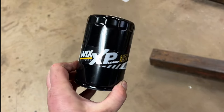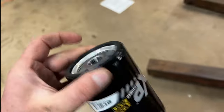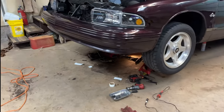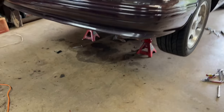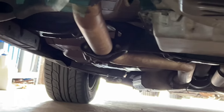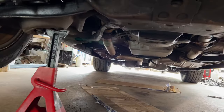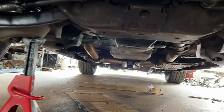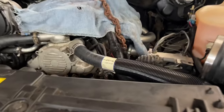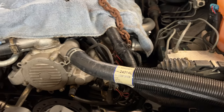Going with the Wix XP high-mileage synthetic oil filter — my old filter wasn't great, so we'll throw this on. Hopefully button things up on the top side. Oil filter installed, starter installed, exhaust is back on. On this side it wasn't routed through the proper bracket, so I redid it so it's nice and tucked up tight. Now just clean up the tools, set her down, pop the chain off, put the coil back on, intake back on — and hopefully with that we've solved our oil leak.